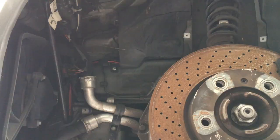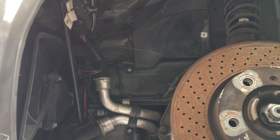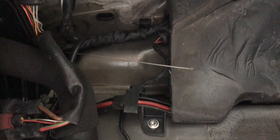If you can't open the front boot — or the front trunk, whatever you want to call it — and because you don't want to put power on it or you can't get access via the normal method of hot-wiring via the fuse panel, then if you look under the trim on the front left wheel arch — I've just removed the wheel arch trim — this cable here actually connects to the front boot. You just grab it, give it a good tug, and it'll just pop straight open.